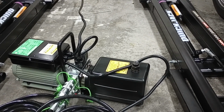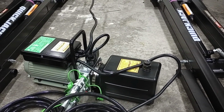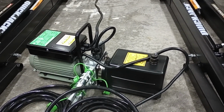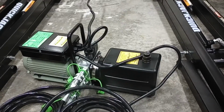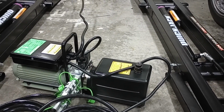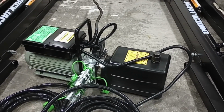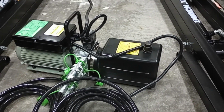All right, so now that everything's down back on the ground, one thing I want to note before you disconnect anything is go ahead and double check how much fluid is in the reservoir. Now remember, your cylinders and your hydraulic lines were empty when you took them out of the package. When you go ahead and fill them up, bleed all the air out, they are going to retain fluid, which means that reservoir is going to lose some. Overall total I took in after refilling was about 2.6 quarts of transmission fluid. So that is right in line with, a little bit actually above, what the manual said. It said 2.5, but 2.6. Go ahead and buy yourself 3 quarts. That way you have the extra as you need.